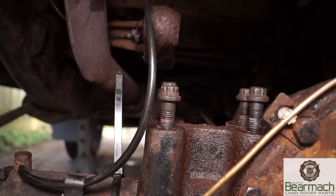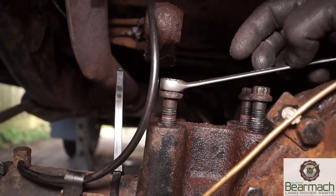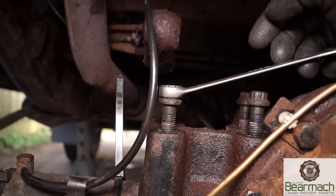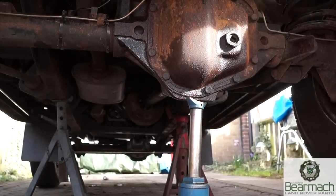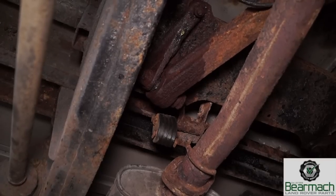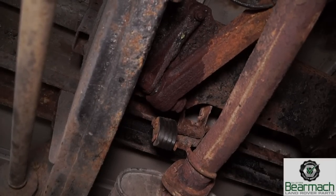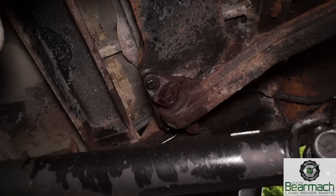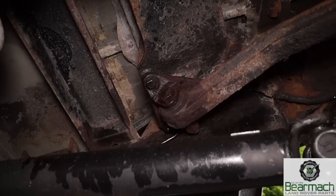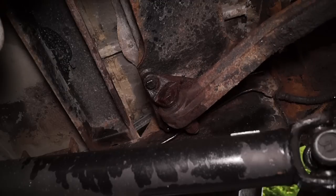It's not rocket science to fit it back onto the axle. Remember we're using a 13mm spanner again and put some thread lock on the bolts. You'll be needing a bottle jack to help you lift the axle to position it to fit the bracket into place. We're not going to show you how to do this because we need to get the upper link arm and the brackets off — the bushes here are absolutely wrecked. These bushes are absolutely spanked, they're knackered, so they need to be removed and replaced. We're putting some poly bushes into these.